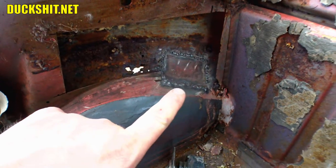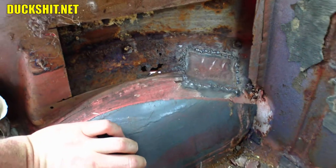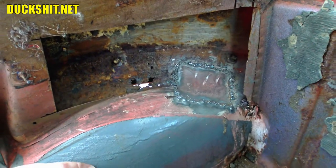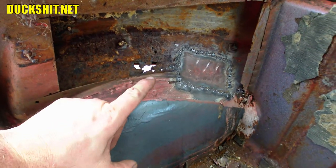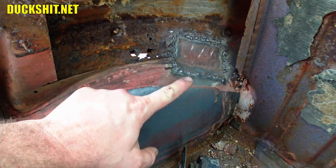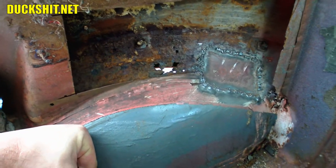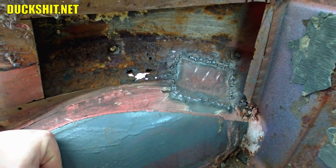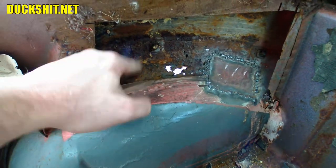She's patched — that didn't turn out too bad. But as anticipated, while I was working around here with the wire brush, it opened up a new hole. It did take off all of the leftover spray foam — death foam crap that was in there. All that stuff started to just fall off and crumble once the panel had any heat in it at all. But it looks like we're cutting another hole out of here, maybe even up to the same size as that one, and welding in another patch panel. I guess we're just going to cut that right out of there. Hopefully as I cut this out, it doesn't prove there's more hole this way.